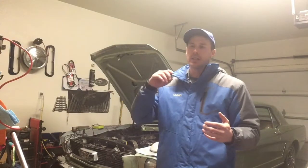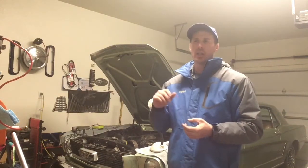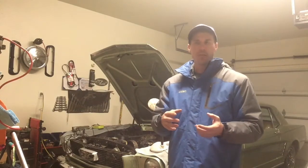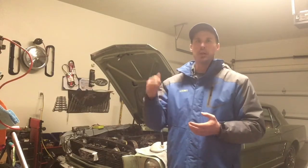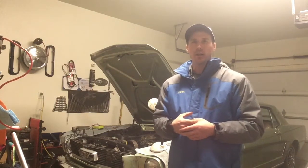Okay, so I torqued down those intake manifold bolts to whatever the Haynes manual said, somewhere around 20 foot-pounds. The carburetor rebuilt does not leak fuel, and I go to crank it up, and it seems like it runs possibly even worse. So I messed around with the float.